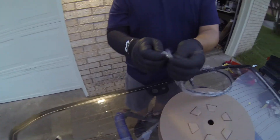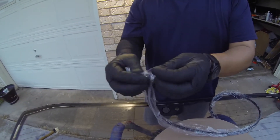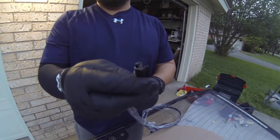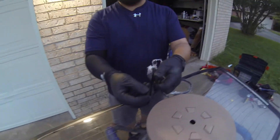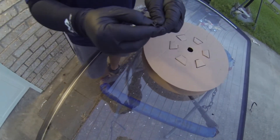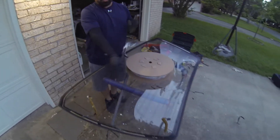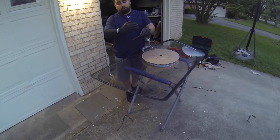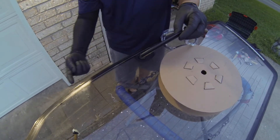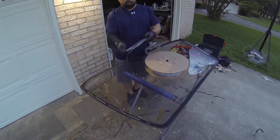This is the molding here that we have on our Facebook — it comes wrapped up. As you guys know, you've already been buying this molding from us for your GTRs and sedans. It's the rain channel molding. It has butyl on the inside. When it gets warm outside, it will make good contact and grab a hold of that back glass, create a good seal, has a rain channel effect. That way the water collects, runs down the sides, and runs off the vehicle. It won't collect on the molding.